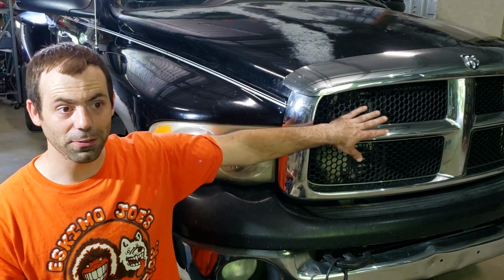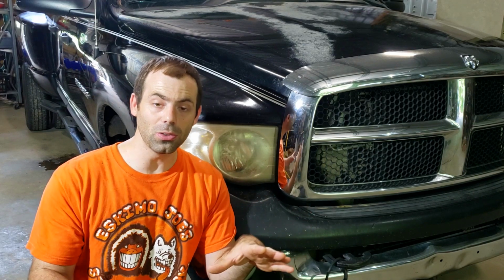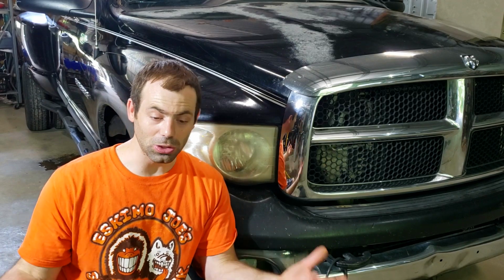As far as injectors, we're going to be using, like I said, those early 03, 04 injectors. So the 305 horse, they use 503 injectors on these guys. This would have normally had a 505 injector for the high output common rails. So we're going to be going early 03, 04, so early common rail injector angle, and we're going to be using a stock 6.7 bowl on the piston bowl, and we'll show you, there's not a lot of information about how this works. We'll show you exactly what that looks like, and we'll show you the result of it.